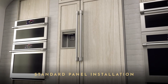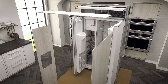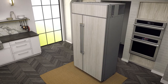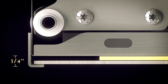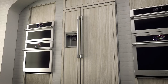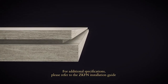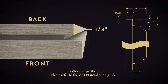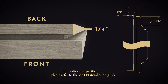For custom panel installation, panels must be cut to specific dimensions and will slide into the frame on the doors and grill. For non-dispenser models, if the custom panel is less than a quarter inch thick and fits loosely in the door frame, it can be backed up with filler material or foam tape to improve the fit. For a three-quarter inch raised door panel, routing is required — the router depth is one quarter inch all the way around the panel back, creating a picture frame. After routing, the panel will slide onto the attached door trim. Additional panel width reductions may be required; refer to diagrams within the installation manual.